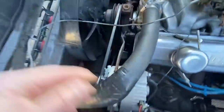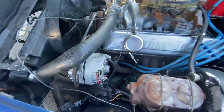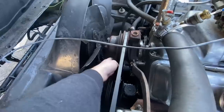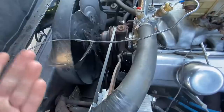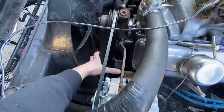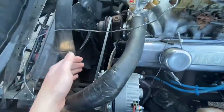Alright, so first I'm going to start off with replacing the power steering belt. It's already off, I just got to put the new one on. It's fairly simple. Once you get the belt in there, there's not much clearance between where the fan mounts up to on that pulley and the crank pulley, so it's pretty tight in there. But if I was able to get it last time, then I'll be able to get it again. All it is, is two 14-millimeter bolts just holding the whole power steering unit in place. So you just loosen it, push it forward, get it on, and then I'm going to use a pry bar to pull back and keep tension on it while I tighten it down.